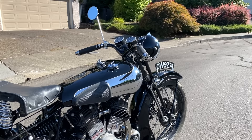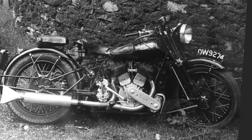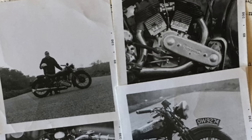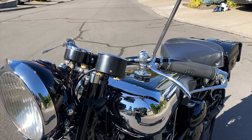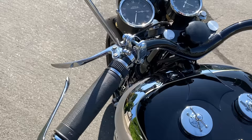This SS80 and also the SS100 were approximately 1000cc motorcycles — 60 cubic inches. These are the inspection covers on the flathead engine that can be quickly removed for valve adjustment. This bike for the most part is as it was when it left the factory; there have been some upgrades over the years naturally, but it's mostly original. Many of the parts were stamped at the factory when the bike was made — for example the frame, the engine, the petrol tank, the gearbox, and the oil tank. This is an original Brough Superior petrol tank but it didn't originally come with this bike; however the owner still has the original tank. These petrol tanks were all handmade with approximately 12 pieces to each tank, silver soldered together and then chromed and painted.